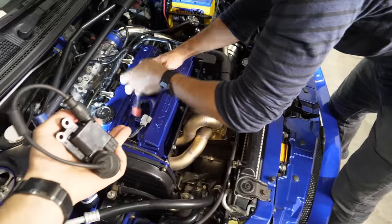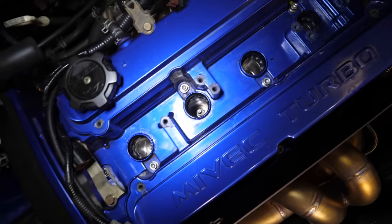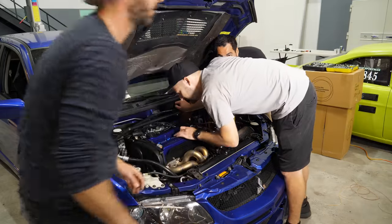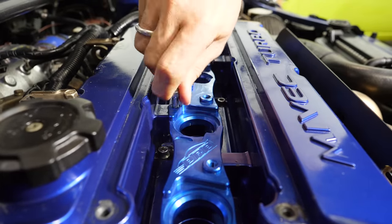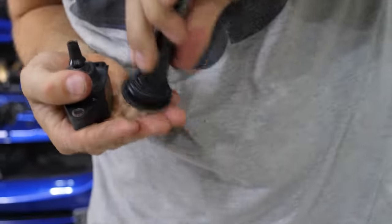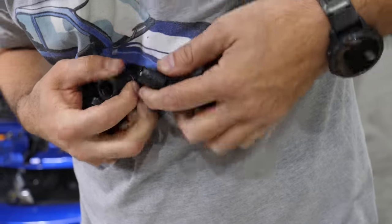The old coils can be removed, making way for our fancy new bracket. It's worth making sure your rocker cover gasket isn't leaking, as the spark plug tubes filling up with oil will ruin your day. The factory Nissan coils have stems on them that are too long and won't fit under the coil cover. Changing the stems is just a matter of removing the factory one, swapping over the spring and boot, and then reassembling. This will make it bolt down tidily onto the top of the engine.